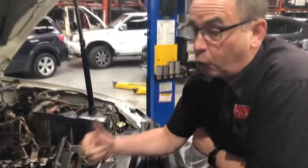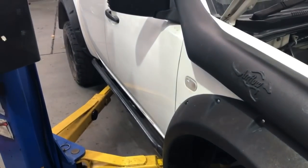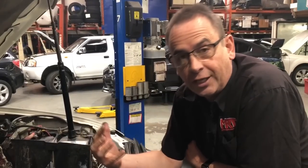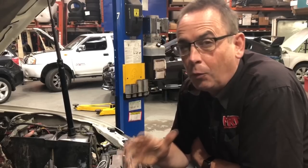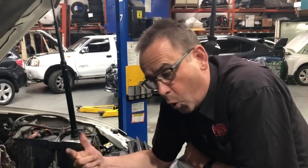He also knew the car needed a custom tune because he'd recently had a problem with the turbo and upgraded to a better quality turbo. So it's got a modified aftermarket turbo, which is a little bit bigger than factory standard. When we do the custom tune, it's going to generate a fair bit of increase in torque — and it will need it, because it's got some pretty big mud tires fitted. When you put those bigger diameter wheels and tires on, it's like starting off in a taller gear, so you need that extra torque.